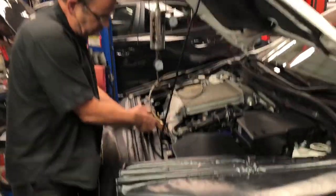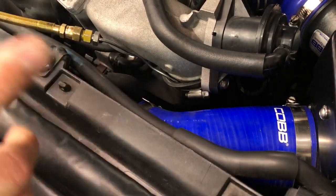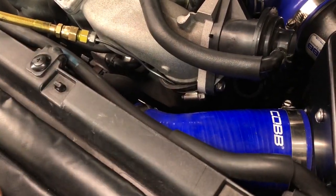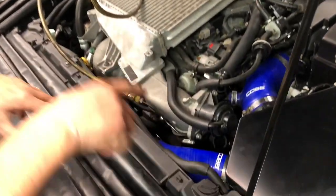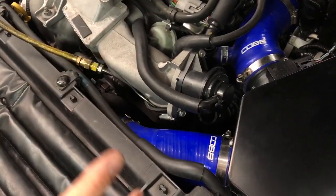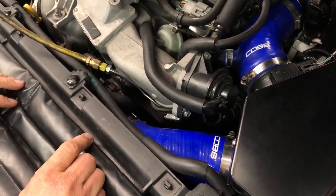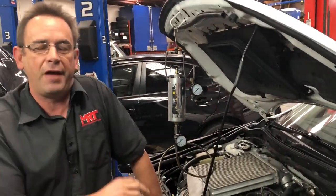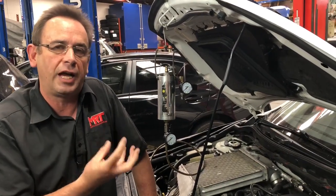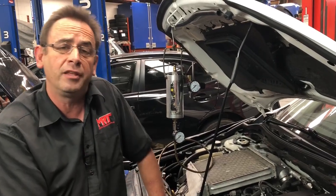What you can see down inside here is the injector nozzle — and what you can't see in there is a nozzle with a fogging device on it. We'll start the car, turn this on, and it will run through a cycling process controlled via the pressure going into the system. What that does is it goes through the engine and cleans both the sensors on the intake side and the sensors on the exhaust side, particularly the rear O2 sensors. But more importantly, it cleans the back of the valves, which over time gets a buildup of carbon due to exhaust gas recirculation going back through the inlet manifold as part of the emissions control system.